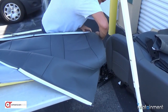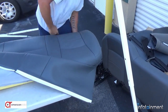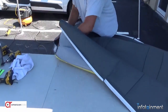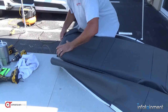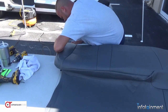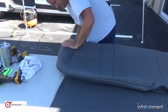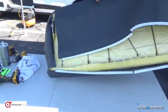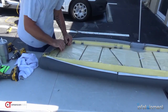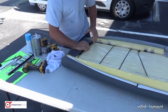So you work that very, very carefully, hold it, pinch it as you roll it over. That corner does tear pretty easy, which if it does, you don't see it because it's behind. The seat doesn't fold down, and it's also behind the plastic. Over, you've got the two J clips, one on each side. Sometimes those are really a pain to clip.